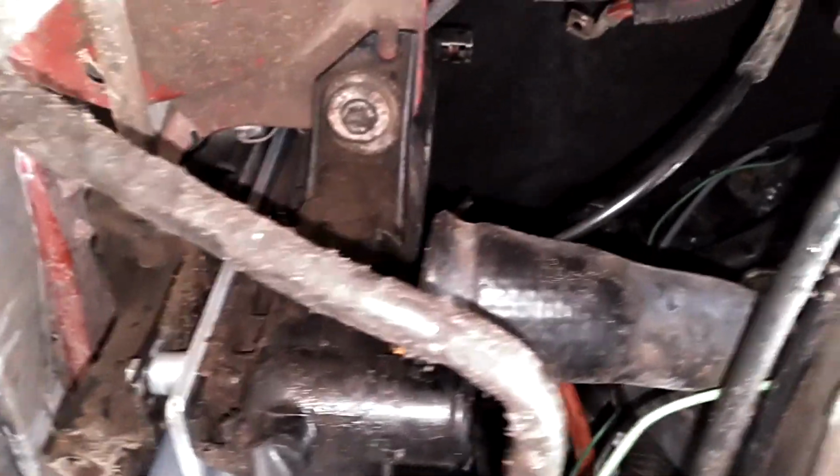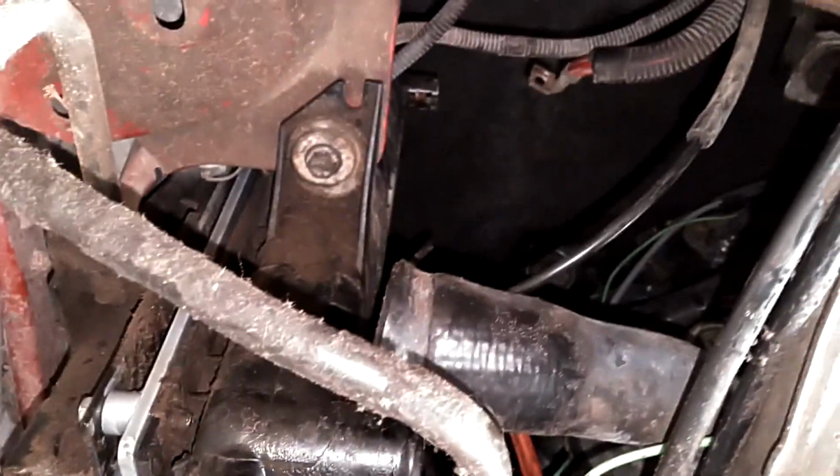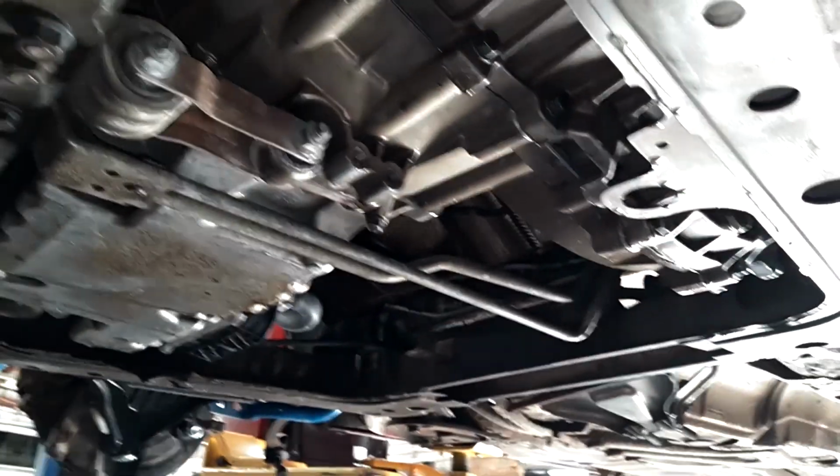We have the control arms in place, getting ready to slide in the axles. We got the canister up there in place, getting ready to hook up this lower coolant line, and then work on the intercooler stuff and install the fan. I think I'm about done for today though. They're about to close down the shop, so I'm gonna wrap up what I can. I did get this mount installed, and I need to install the bolt there and tighten this bolt here. So let me get that going and wrap this up for today.